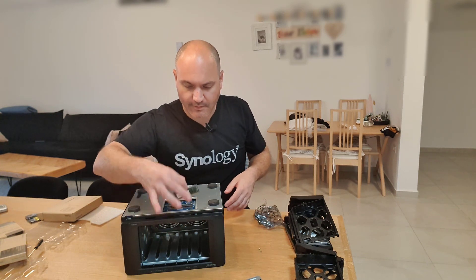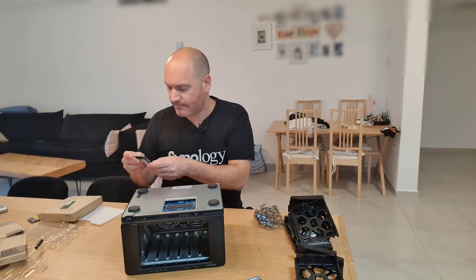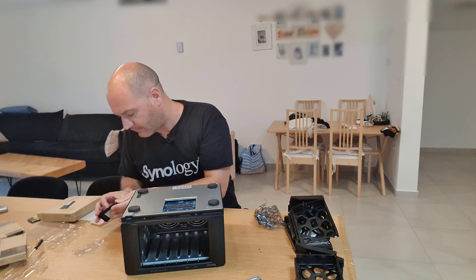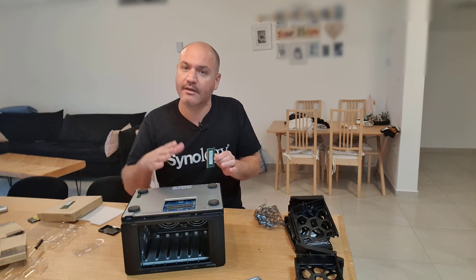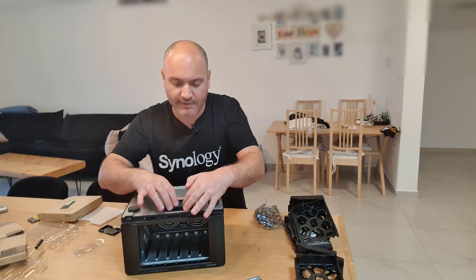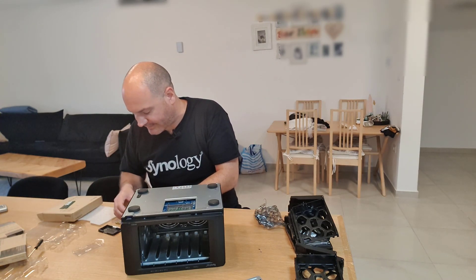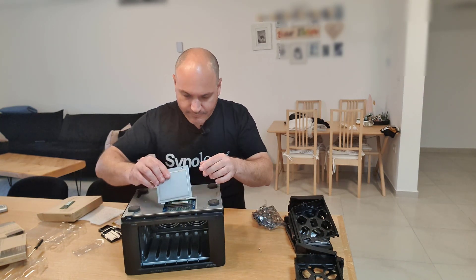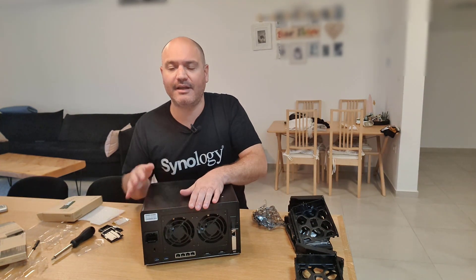We'll open up the RAM tray with a regular Phillips head screwdriver — nothing more than that. Take out the metal plate that covers the RAM slots. We'll take out the 4-gigabyte built-in Synology RAM module and place it aside — hold onto it, don't throw it away. Now let's take out the RAM we'll be upgrading to. I admit I'm using an unsupported RAM that is not on the compatibility list — I'm taking my own risk, and this will probably void my warranty. Take that into account; it's your risk to take. These are regular SO-DIMM form factor modules, just ECC — same size, same mechanism as upgrading RAM in a laptop.